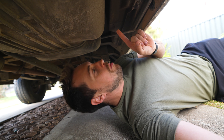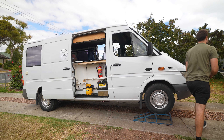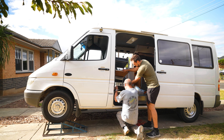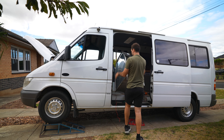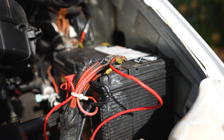The plan is to unbolt this metal frame. These bolts are easy to find but we have to go so far back to get the others. Halfway through getting the bolts off, I'm realizing it's all plugged in electronically too, so I've got to figure that out. We've got the bolts out but found there's a cable running through, so we need to be very careful and isolate the electronics so we don't get electrocuted. Whatever was done to this van has put a lot of electronics linked out to the main car motor starting battery — I don't really know why. Apparently it's a 20-amp cable but a 50-amp fuse.